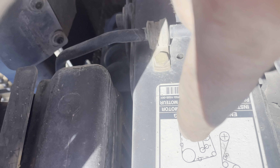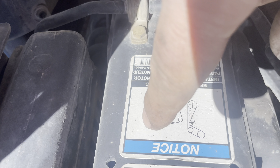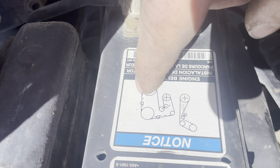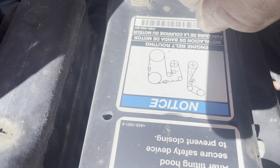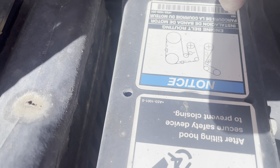So you got your diagram right here. You feed your belt around the fan, lay it on the top, and come around here. It's gonna just be floating in there — you don't hook it on this bottom pulley yet, it's gonna float around there. You loop it around that one, and you won't put this on right away — just pop it around that bottom pulley or around that tensioner. Once you get it on the tensioner and it's sitting on there, you can take it off the alternator or whatever to make it easier.